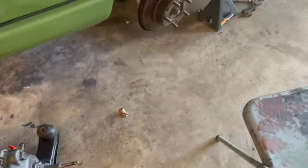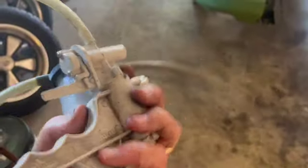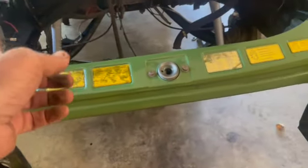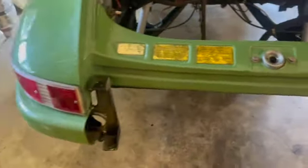So what are we doing today? We're finishing our brakes. We got our brake calipers installed. We're pulling out the old brake fluid and bleeding brakes, using the power and the magic of the old gun here. We're starting in the back, at the brake caliper away from the master cylinder, and just working our way around. We'll do this side, we'll do this side, and we'll do the back side twice. We'll keep pulling, going around probably 2 or 3 times, getting that out.